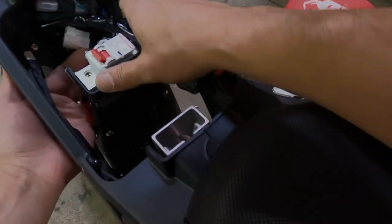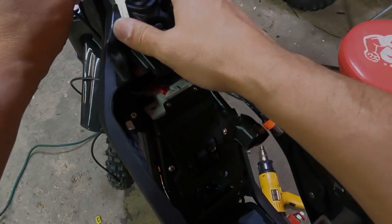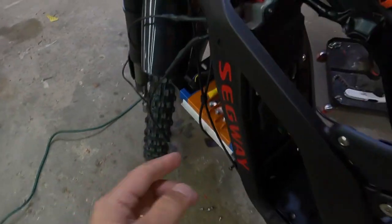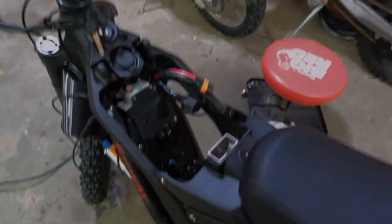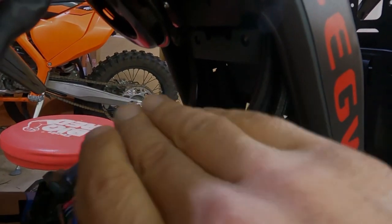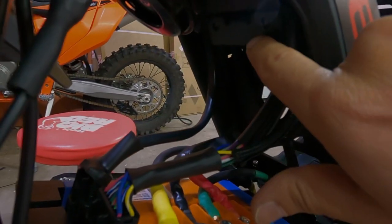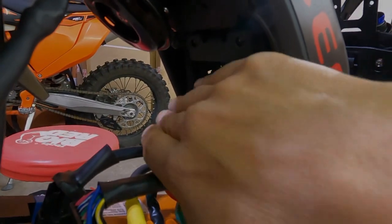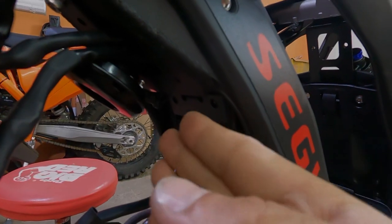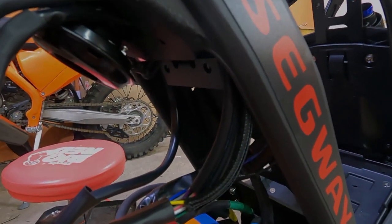I'm just pushing more connectors through here through that crevice so that we'll have lots of room to close this. All right, now we can just close this like this. And we're good. Just need to install the bolts. One right there, and the other one on the other side. And after that, we'll start closing this up. All right, so I've moved this harness's wires to this edge, and that harness's wires to that edge to free up this area, because that's where the bracket is going to mount to, so that when I close it, I'm not pinching any of these wires. It's a really tight fit. You also have to move your horn sideways out of the way so that you can bring this over and screw it in.